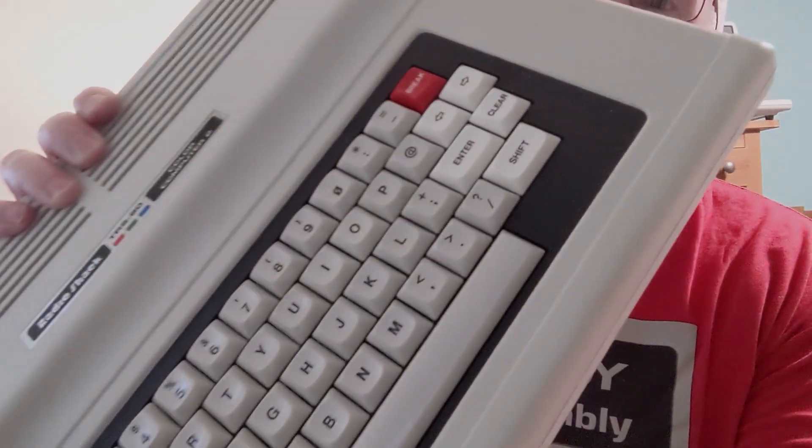Quick TLDR: these keys can be pulled out — I have the melted keyboard on the Coco 2 and the keys can be pulled out with a key puller, then you can just clean it out. I didn't know that at first, so I went from the back. I clean the mylar strip and everything except the little plastic pieces that push the keys back up, which were spotless, so I left those alone. I use NAPTHA and alcohol to clean everything, and it all works great.